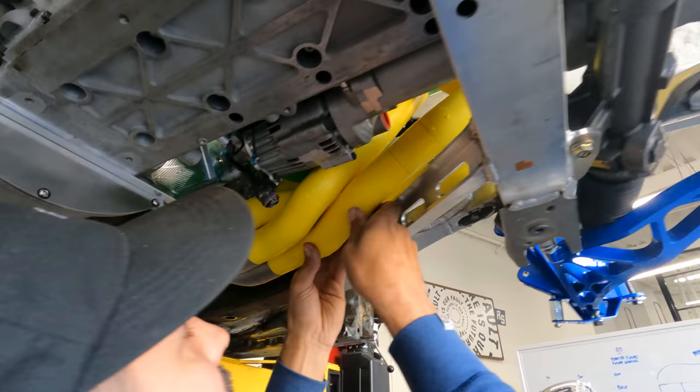So Dom's gonna make some Delrin bushings to go in here. We're gonna run an inch and an inch and a quarter sway bar so we have the different sizes that we need for this thing. And then we have to make the arms to go out to here, but we are gonna replace this YSFAB lower. So we have a lower control arm that doesn't have the divorced spring location.